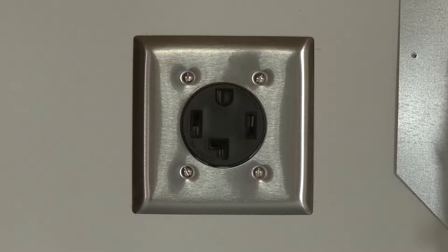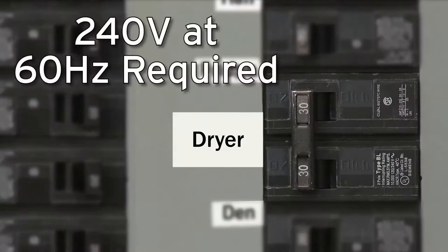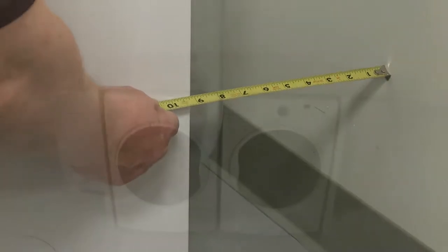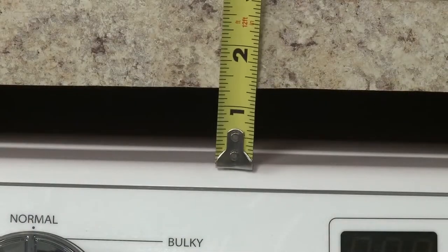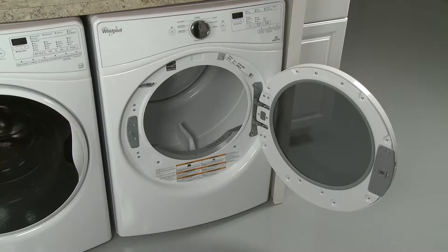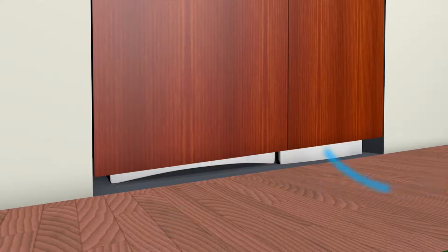When using a power cord, a grounded electrical outlet will need to be located within 2 feet of either side of the dryer. The electrical supply for the appliance must be 240 volts at 60 hertz. A dedicated 30 amp circuit is required. The rear of the appliance should be positioned no closer than 5 inches from the wall. If installing the dryer in a cabinet or closet, allow for at least 1 inch of space on the sides and top of the appliance. There should be enough space to allow the door to fully open. If a closet door is used, the door should be louvered or space left at the top and bottom of the door to ensure adequate airflow.